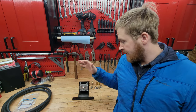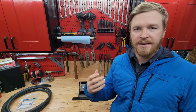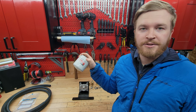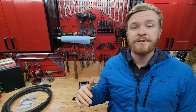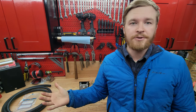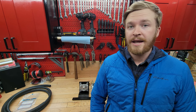My goal with this is to install one of these to take a lot of the contaminants out of the coolant system — any debris or particles that can clog up the heater core. A benefit is yes, I can keep the chemicals in check, but you can also get these filters without any additives. I'll link down below a 10-page document put together by Cummins and Fleetguard that goes over what a coolant filter is, why it's important, and a catalog of different filters available based on engine size. It's just a good document to read through.